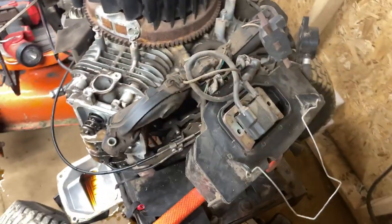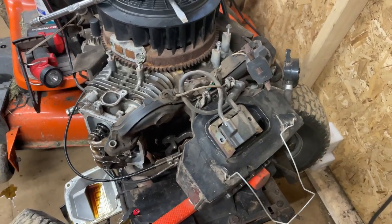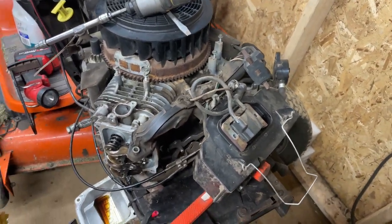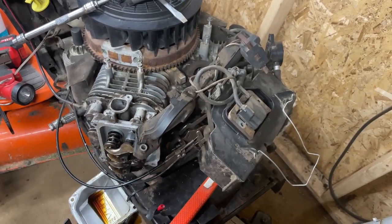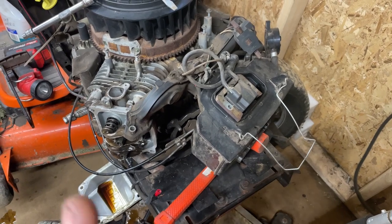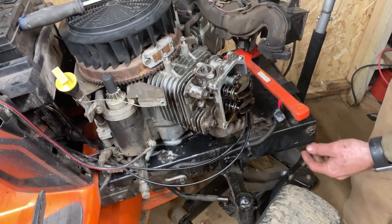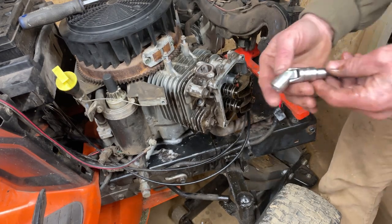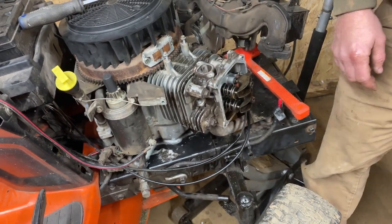Just keep track of yourself and take pictures, guys. Pull out the service manual if you don't have a paperback. A lot of times I'll snag a few pictures right before I take things off. Your service manuals nine times out of ten will have all the stuff you're looking for. It's just a time saver. So we remove these sneaky bolts from the exhaust — I like to use a swivel to get in there on a long extension. Works pretty good for zapping them out quickly, saving a little time.